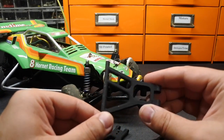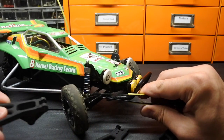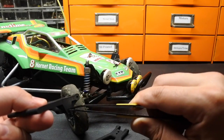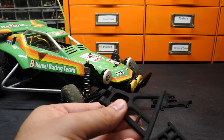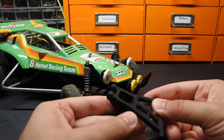When it comes to the 20mm offset version, the 20mm offset means the mounting point here would be at zero and the mounting point relative to the original is 20mm lower. This version has a little stamp that says R. The left will have an L, so these are unique to each side.